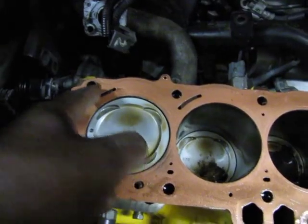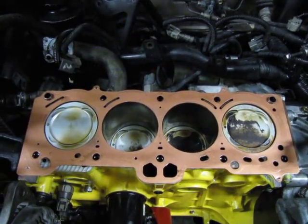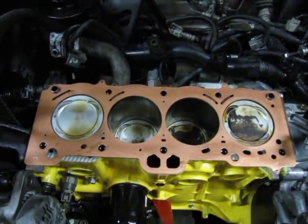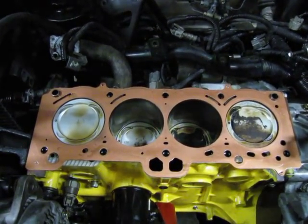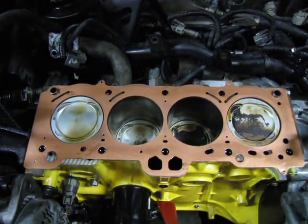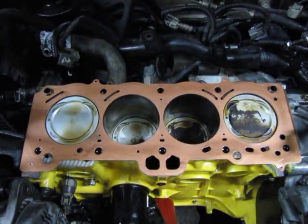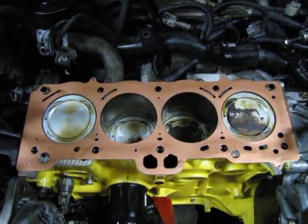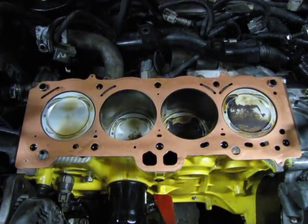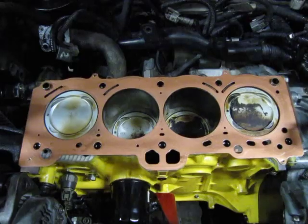Even though these pins still line up. So if you're getting a major massive oil leak and you just changed your head gasket, you might have put it on upside down. This sucks big time, but I had to share this because if I can prevent somebody else from doing it, it's worth the embarrassment. First time in 45 years I've ever done something like this — a completely major mistake.